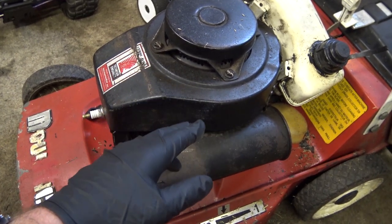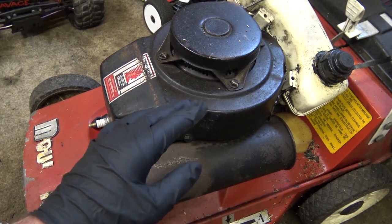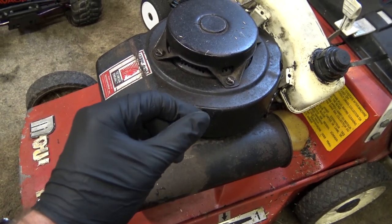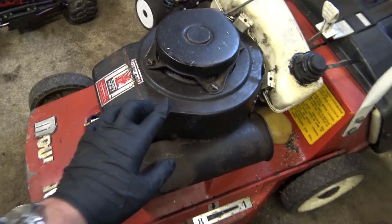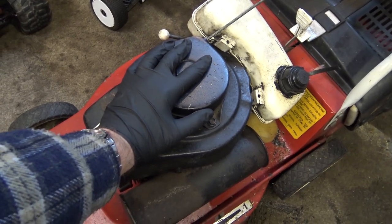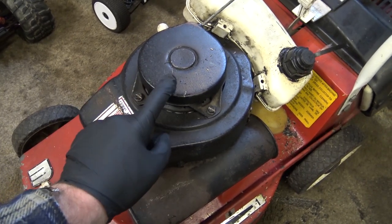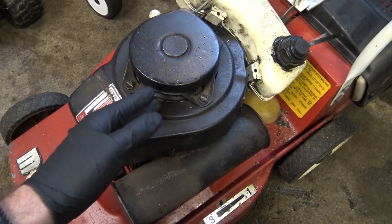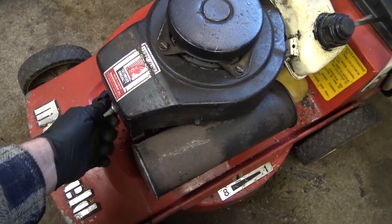They're not really bearings in there, they're shells. Anyway, I made one and it ran okay, but then I decided to tighten the bearing up a bit more. What happened was it got quite hard to turn over because I'd over-tightened it. One day I went to start it up, pulled on the cord, and heard a snapping sound - and then it wouldn't start. I think the keyway on the flywheel has snapped, because when you pull-start it you're trying to turn the engine over and I think the keyway snapped, which is why the timing's out.